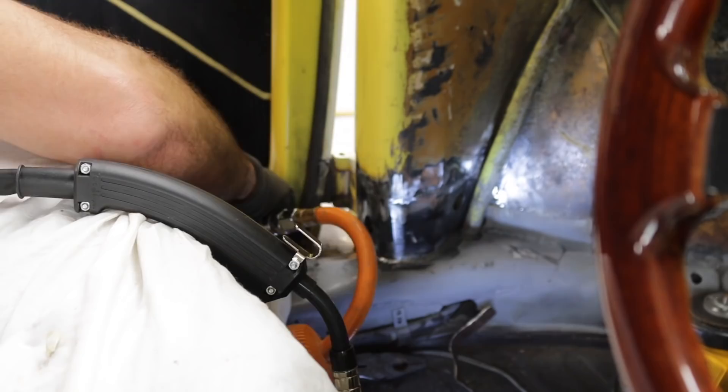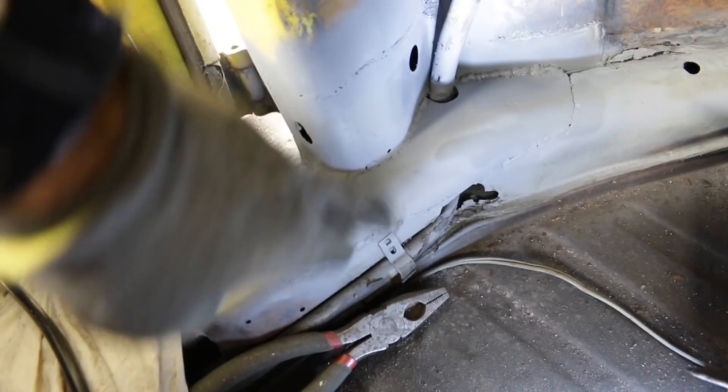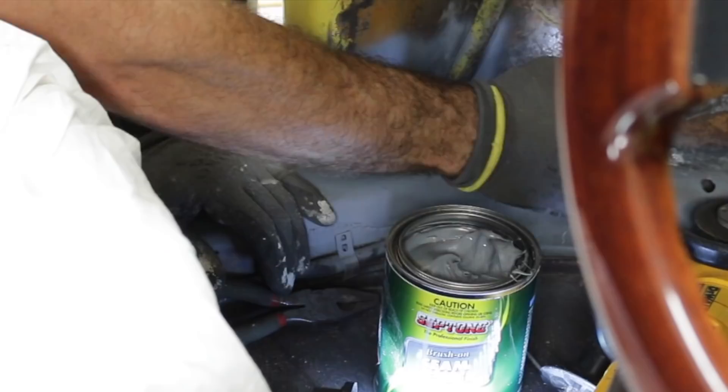You can see in there that it's all new panels in here now. You can still see the edges of where I've welded the panels in but they're pretty close. I'm just going to go along these edges here — these factory joins — again with some seam sealer, and that should be a wrap.